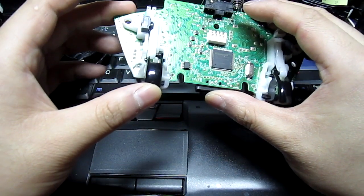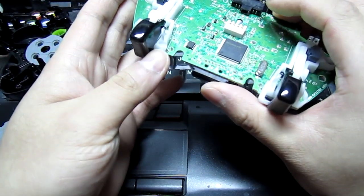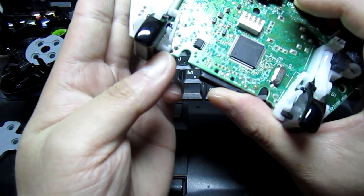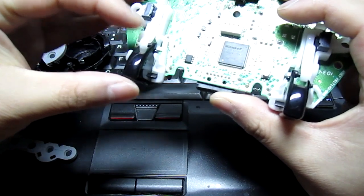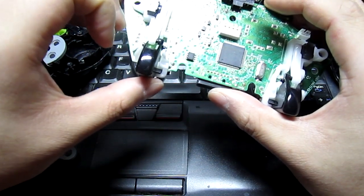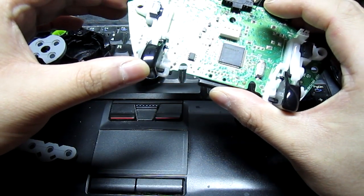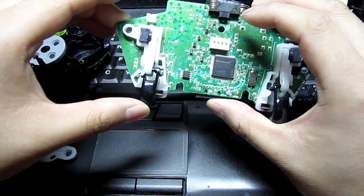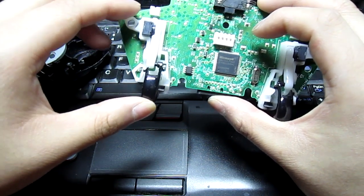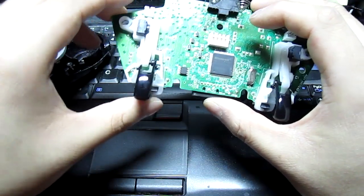So let's say I just screw it all the way down, and what that set screw will do is slowly push this trigger down a little at a time. It's almost like gear ratios, where if you push this down a millimeter, that translates to much more than a millimeter displacement in this entire lever system. So I'll have that mechanical set screw in, and I'll slowly screw it down. As it pushes this, it'll eventually get to the point where I've actuated this trigger enough for the gun to fire in the game, and then you just back it off a little bit so that the action no longer occurs. So basically, once you touch this trigger, it fires the gun. And that's the plan anyway.